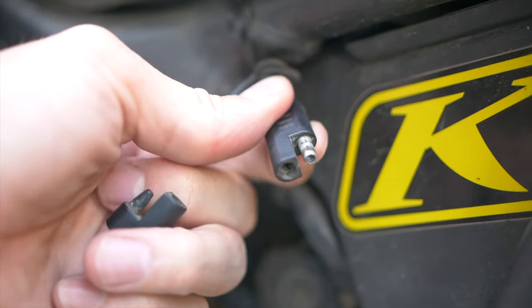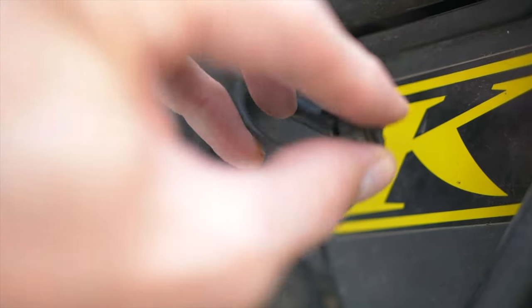I have a little pigtail that comes off the battery that I tuck away underneath the seat so I can power anything I need — under the seat, on my person, or in my tank bag. No matter what kind of riding you're doing — commuting, touring, anything — having some way to get power from the battery to your person or tank bag is vitally important. It'll probably take you less than half an hour to attach it to the battery, run a line up, and zip-tie it to your frame. The SAE connections will go to a variety of different accessories and charging options.